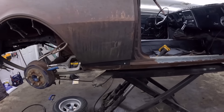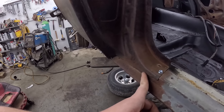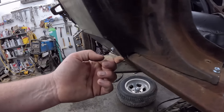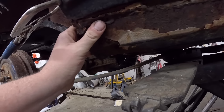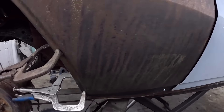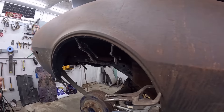Honestly, it wasn't really that difficult. I clamped this over so it's all in line doing its thing. That was the same with doing the other one so we can burn that in. There was actually a little structural piece here which I just grabbed a self-tapper and pulled it in. There's just a little bit of a gap, same front and back. But look at this — this is beat, it's been pushed in. I think it's probably pretty well in line. The door has to go in a little further if anything. So that's fine. We've got a bit of a gap there so we can adjust the door. I think the quarter's happy — as happy as it's going to be.